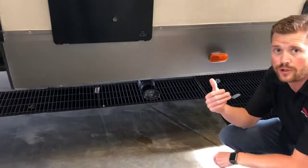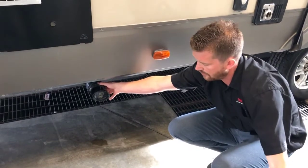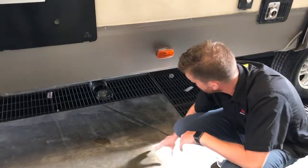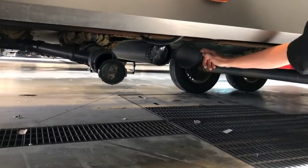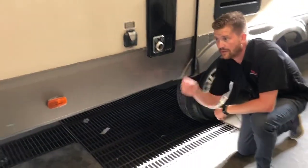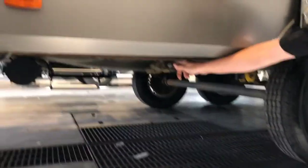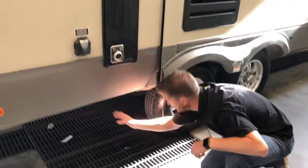We supply a new 20-foot medium heavy-duty sewer hose with the RV. When you hook up the sewer hose, it hooks right under here and the other end goes into the ground. Remember your sewer tank dump valves are up at the front in the front storage compartment, and sewer tank storage is right here. Important to note that you've got two grey holding tanks on this trailer — one specific to your bathroom and one specific to your kitchen. There's only one sewer hose hookup, but you will have to dump both grey valves when dumping your holding tanks.